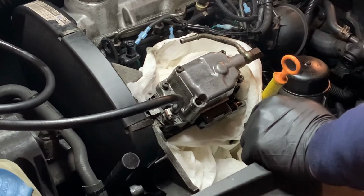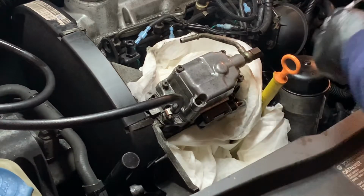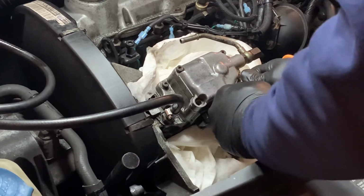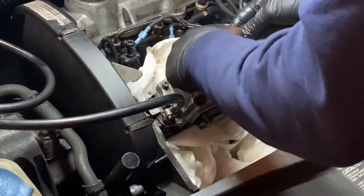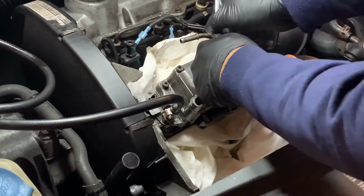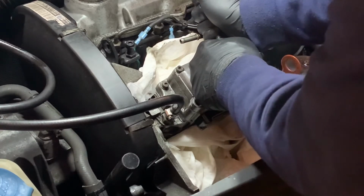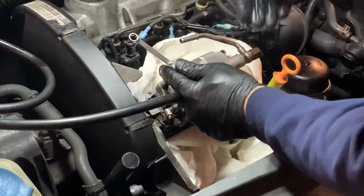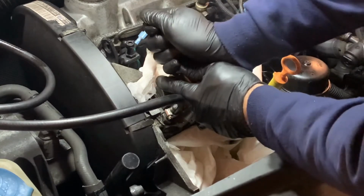Okay. The next half. This one, that one, and that one. Yeah. I'm pretty sure I've broken these loose before to do the hammer mod, where you slide the whole head a fraction of a millimeter left or right to adjust fueling. That's why they call it the quantity adjuster. It slides a thing left and right.